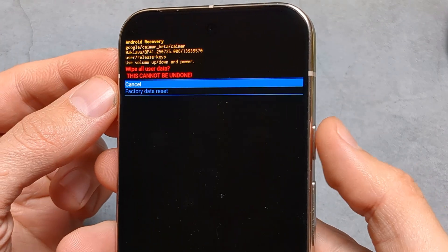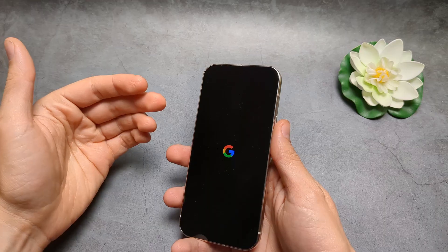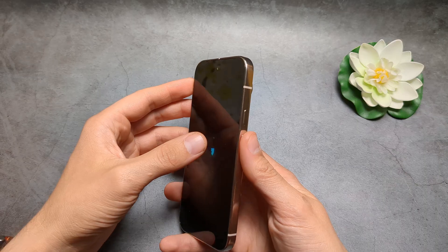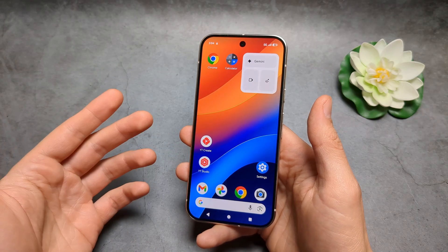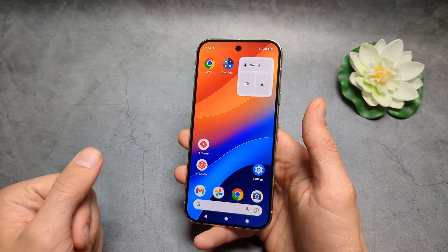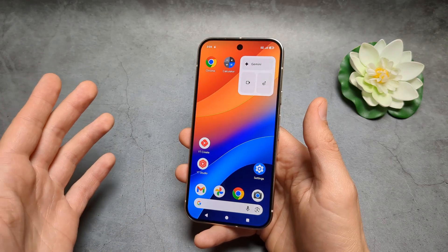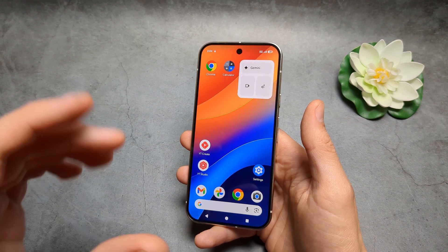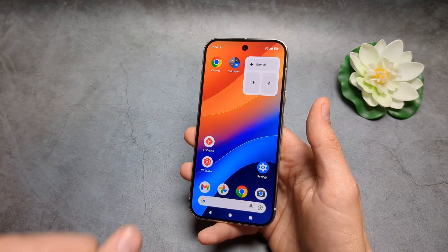I won't do that at the moment as I have no need. What you have to realize is that once the setup screen comes up, it will also ask you to log in to your old Google account that you had on this phone. If you do not remember the Google account and password, do not do this step, as you have a chance of actually bricking the phone. This is only for security reasons in case someone steals your phone and tries to do it. You have to know your Google account login details to be able to get access to this phone after you do this process.